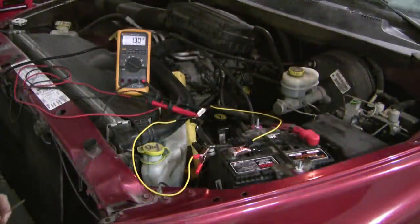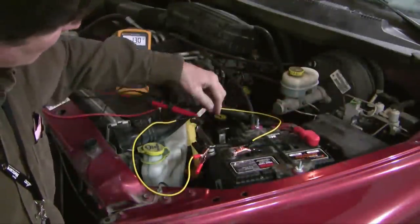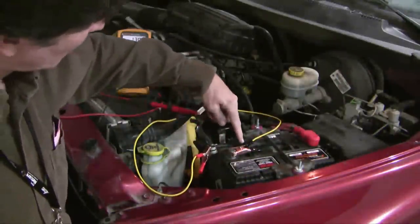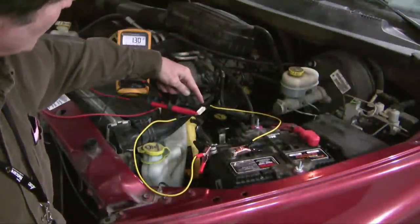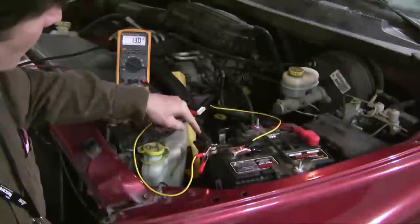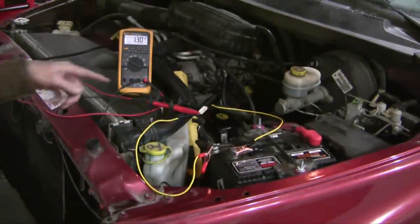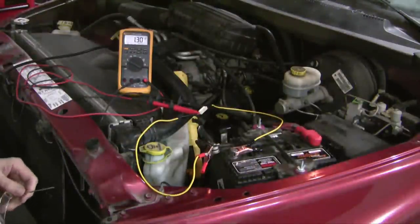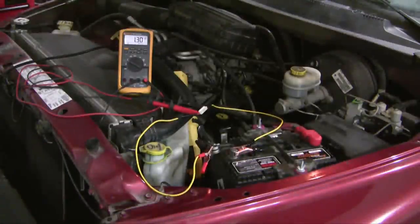So let me explain again how I've got this worked out. I've got my battery hooked up correctly to the positive side, and to the negative side I've unhooked the battery to all of the rest of the car. In its place, I've rewired the negative connection through the battery through this 1 ohm 10 watt resistor, and then back through to the negative cables. And so effectively what I'm going to do is measure a voltage drop across this 1 ohm 10 watt resistor. And because it's a 1 ohm resistor, it means that my voltage drop there in volts is equivalent to the amperage that's going across that resistor. And so in this case, I'm drawing about 1.3 amps through that